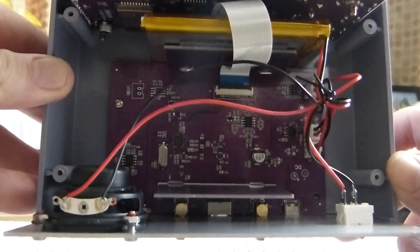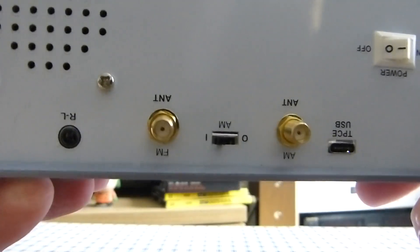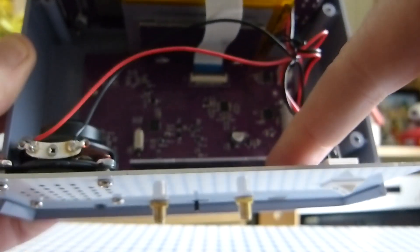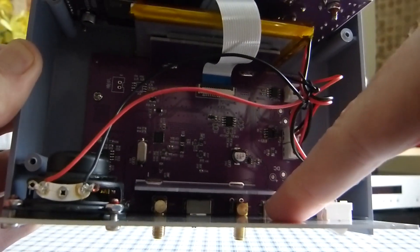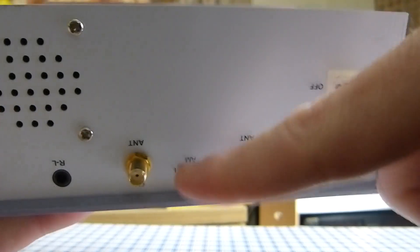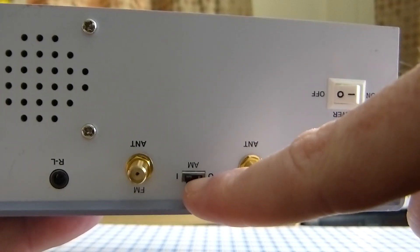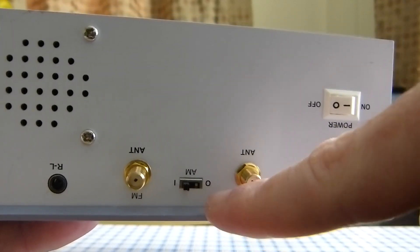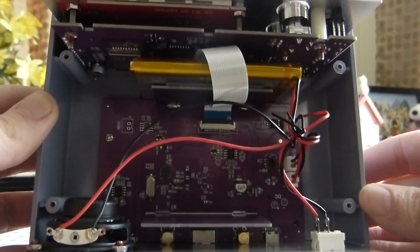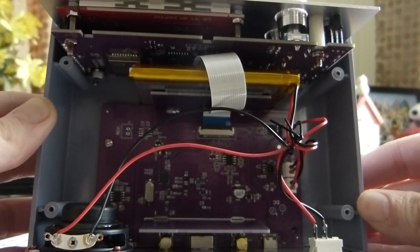Unless you see something, you spot something that could act as an antenna. You've got the back here — the AM antenna goes in there and then through here. Obviously this radio works fine with the AM antenna with an external antenna. But in terms of the built-in antenna, where is it? You've got the switch here — you switch between having the AM built-in antenna on, one, versus having it off, zero. And I just cannot see anything to say that this radio does have a built-in ferrite antenna.